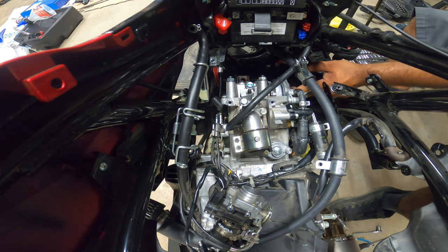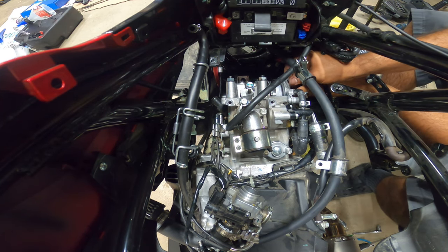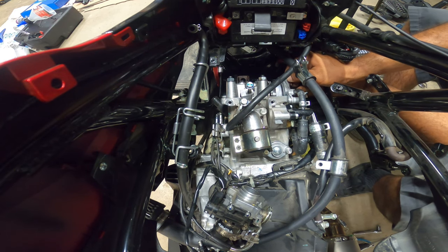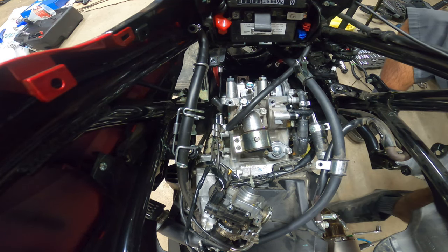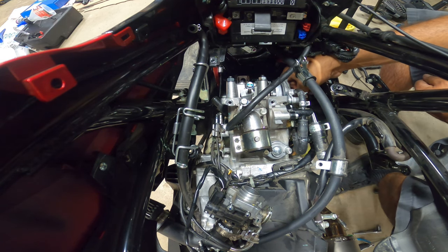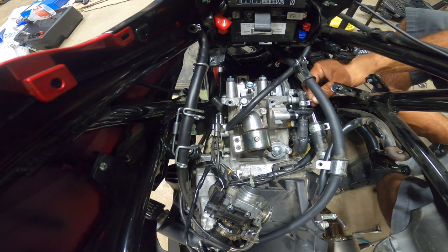What I do is keep constant pressure on it. And I do the little 8mm on the right first. It's the only bolt that doesn't bolt to the actual motor. It only clamps everything down together for you. Again, hand tighten. And then get the other three in here and just get them started. And these are three 10mm bolts.